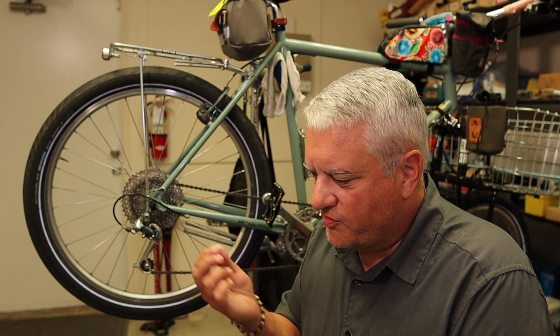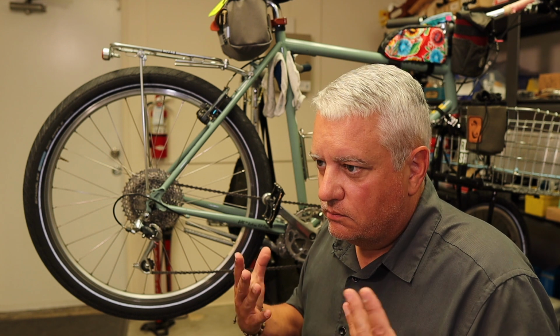This is also an opportunity if you do have a little oxidation, but it's not bad. You can use a little steel wool on the cable. Shout out to Tom Pettigo, the king of steel wool. And then you can add a little lube, a very small amount on your finger, just rub it back and forth on the cable, and then put everything back together. And when you start pedaling the bike again, voila, that cable's gonna cinch back up right where it's supposed to be.